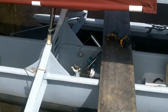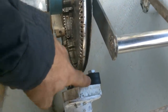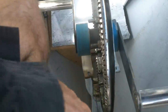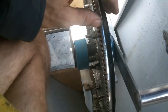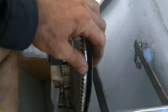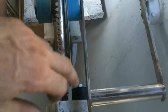This gear here fits in here and presses against this gear, pushed against it with this rubber wheel. The rubber wheel was pressing against this round pipe, and there wasn't much surface area for it to really push on. Once in a while, if I was pedaling hard, it would skip a gear and make a terrible sound. It didn't get damaged because the material is really strong, but I'd like to fix it. So I'm putting this flat plate along the back — not sure if it's thick enough, it might get bent over time, but it'll give a better surface for the wheel to press against than just that pipe.